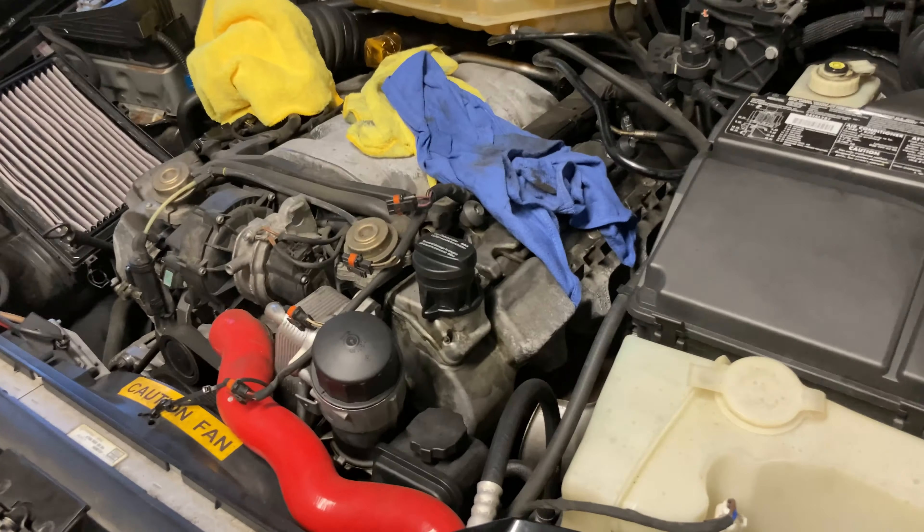It's easy to think 'while I'm in here I might as well change them,' but if they're still good it's kind of pointless. The spark plugs are a lot easier to get to once you have the valve covers off, so if you're doing both jobs, do the plugs after removing the covers. I've got all the bolts out — make yourself a little map. There are only two different sizes: medium length and really long ones. The four long ones go on the breather cover.